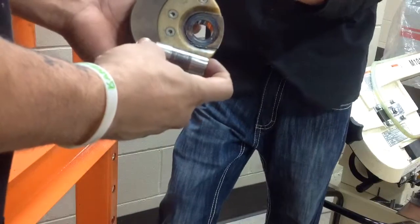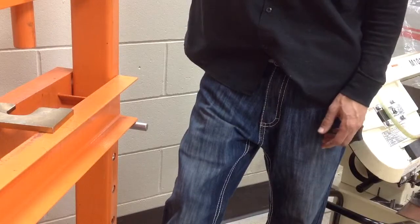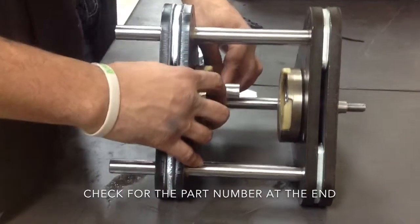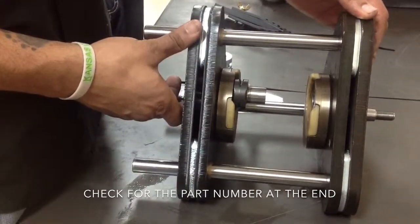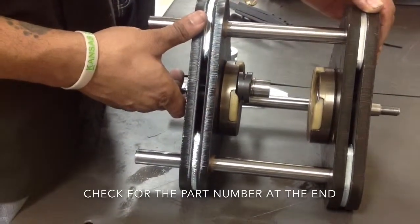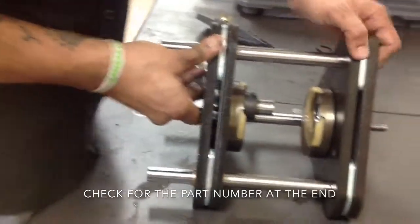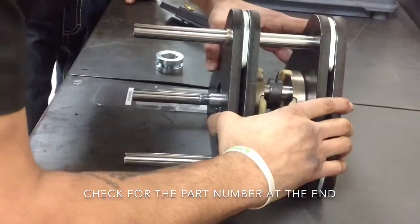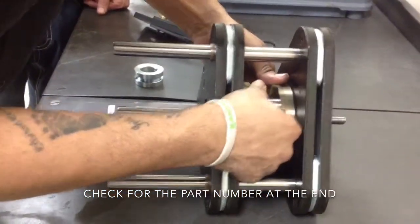We'll reassemble with the new parts. The pin has been pressed into one crank web. I don't want to hide anything — that is the old rod and the old pin, we're putting it back together as practice. I'm just going to slide the two halves of the jig together and then line up the holes for each crank web for that bottom end, the big pin.